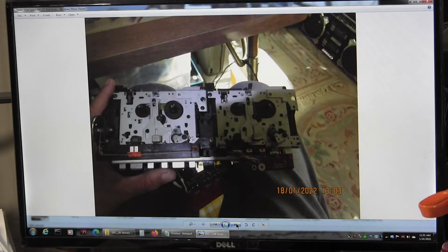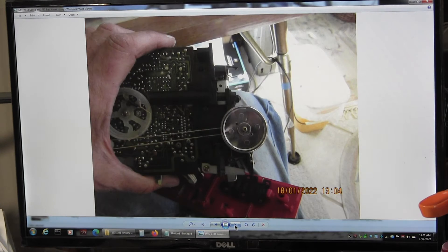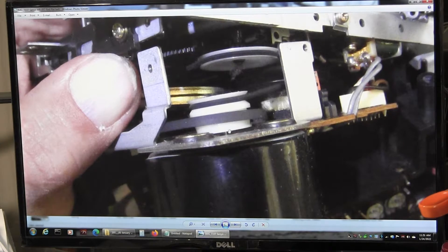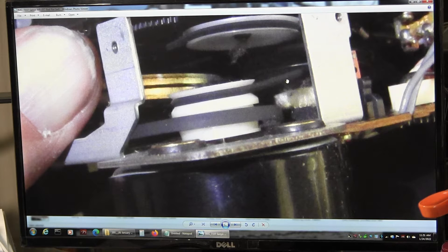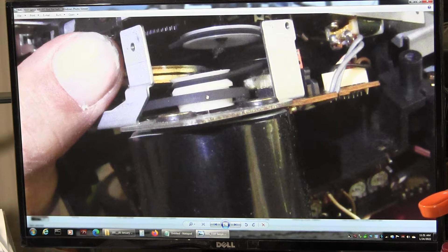This is a very nice auto-reverse playing model. Now going back — this is the Sanyo MR FF7. This is the deck of it; you can see the red part right there. I just took these pictures as I tried to re-belt this. This is very important: it has a flat belt on the bottom with some brushes to keep the belts clean, and the flywheel does not have a track for the flat belt to ride in. You have to install the flat belt first, then install the square belt on top.